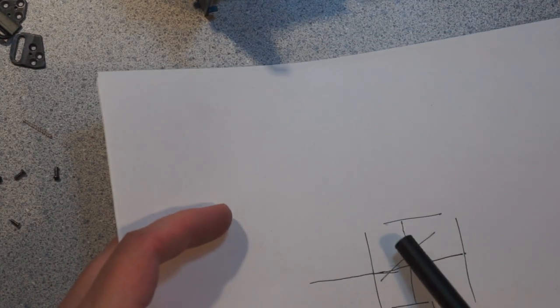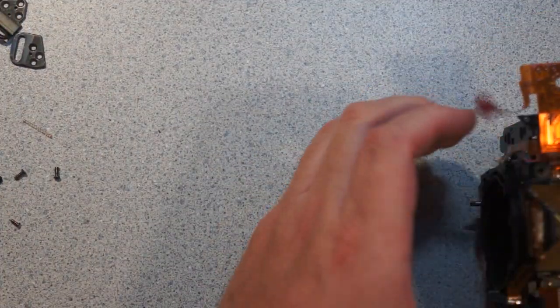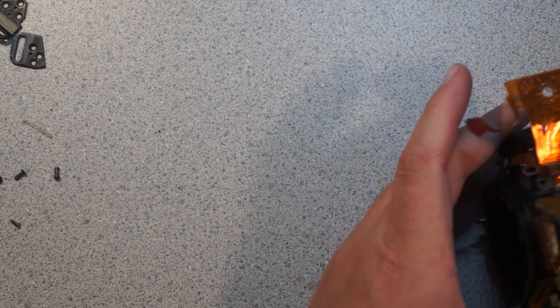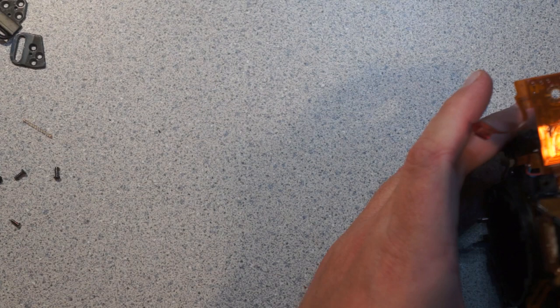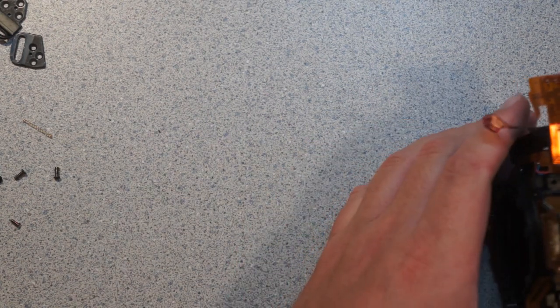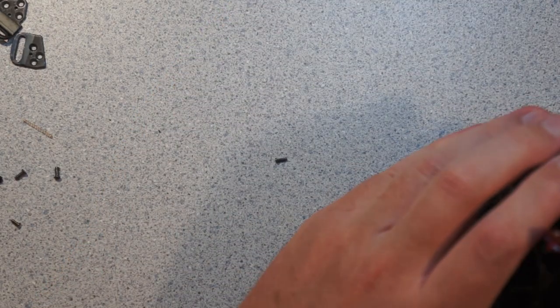Again, it's just an issue of one of them being the viewfinder focus, one of them the autofocus focus, and one of them the actual film focus. And they all have to match, basically exactly. So there's a lot of really fine tuning in these things, which is why SLRs are still expensive.